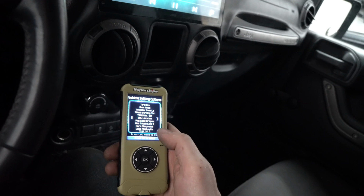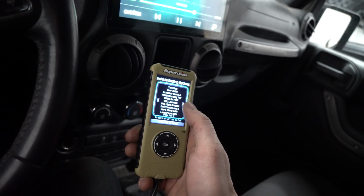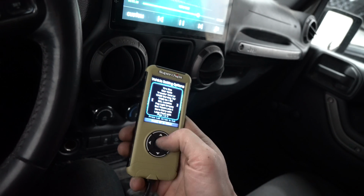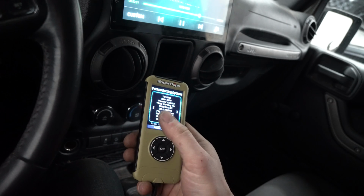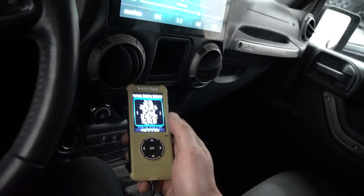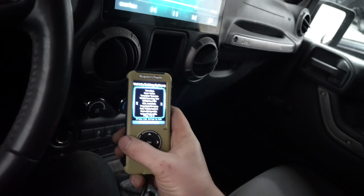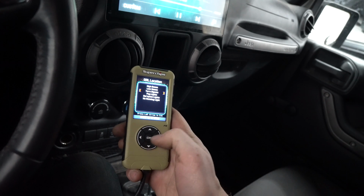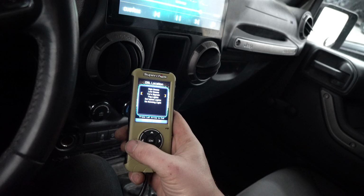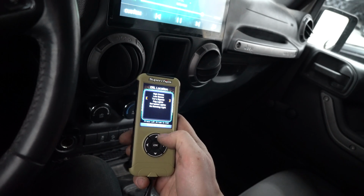Or if you bought different headlights that have a DRL and a turn signal flash, you can wire one to the turn signal and then change the DRL location to the fogs. So the fogs will keep the halo running all the time, and then the turn signal will activate the other one. Again, DRL location for me is always turn signals, because it's so easy to grab the wire. Because what we're going to be doing is taking off the front grille, and the turn signal wires are right there, and I'm going to show you the wire colors.